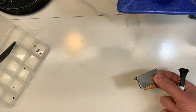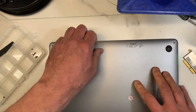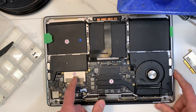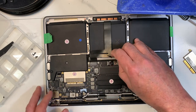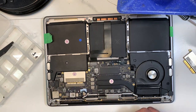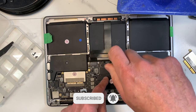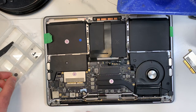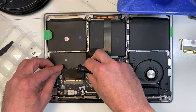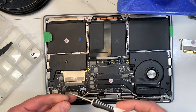This MacBook is dead. I have a working machine — exactly the same, it's a 1708. So what I'm going to do is remove the battery first, and now I can remove the hard drive. Then I put the other hard drive in. There you go. And that's how you recover the data on a dead A1708.